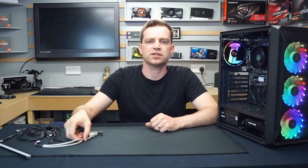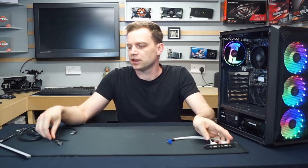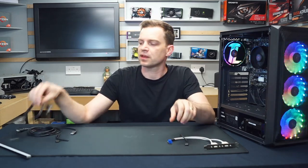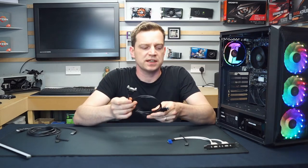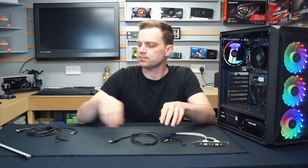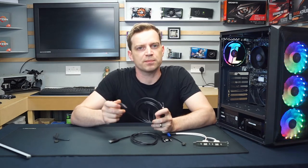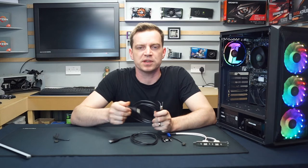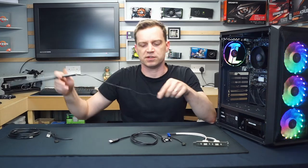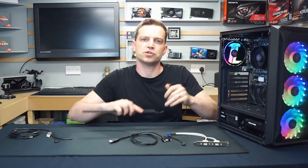To do this, we're going to use USB ports on a PCI card. We'll need some four-pin RGB connectors, a panel mount USB connection — replacing the white ones with black ones so they blend in — and then we'll build a cable that hooks into the existing controller, whether that's a four-pin system to the motherboard or a six-pin system on a Cool Moon. Then we need the lighting itself, which will be on the outside synced up to the built-in controller.